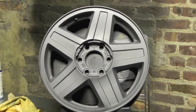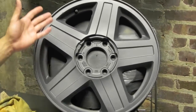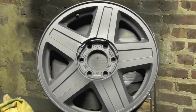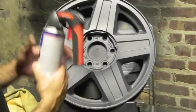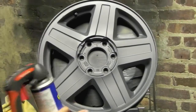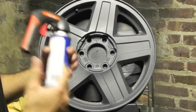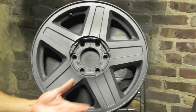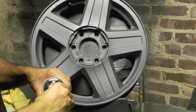Alright guys, this is the rim after five coats of the Gunmetal Gray. As you can see we got full coverage on the rim and it's completely covered with the Gunmetal Gray. So now we're going to give it a few coats of the Glossifier. Now, this Glossifier is a little bit thinner than the regular Plasti Dips, so you want to make sure you're careful and not saturate too many areas because you will get some drips in there. When you start this project, just try to know how much gloss you want — do you want a satin gloss or do you want a wet gloss? Alright, so let's get to the first coat.